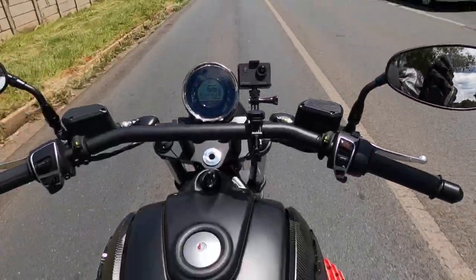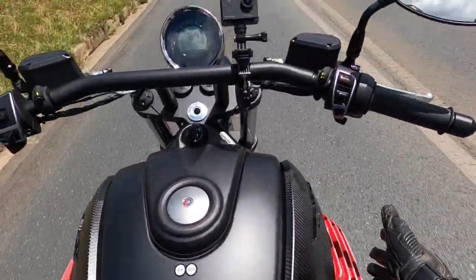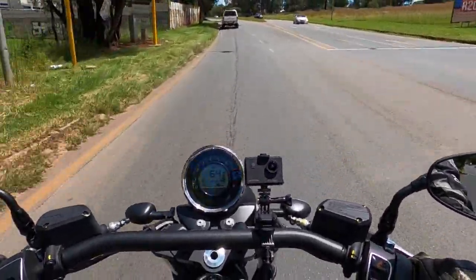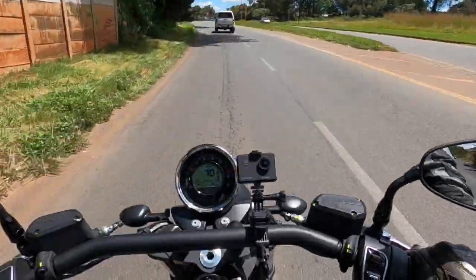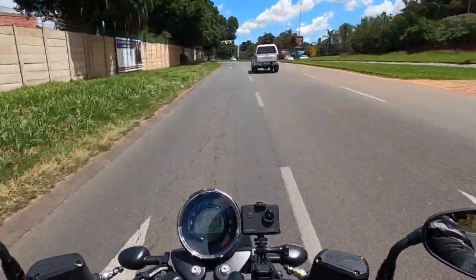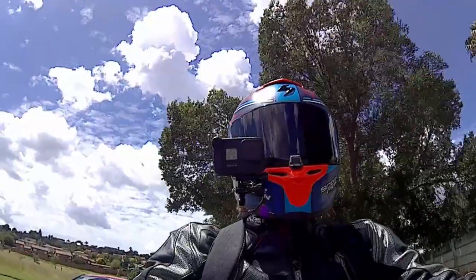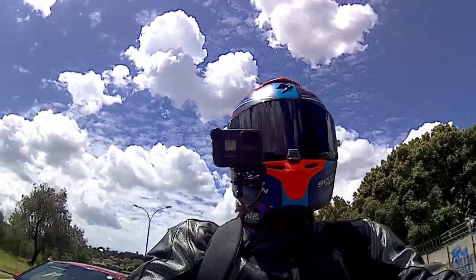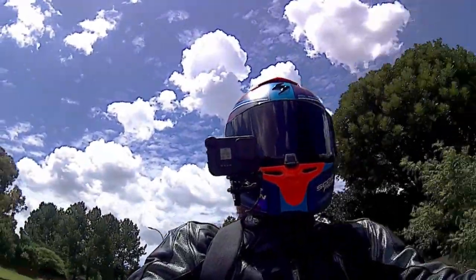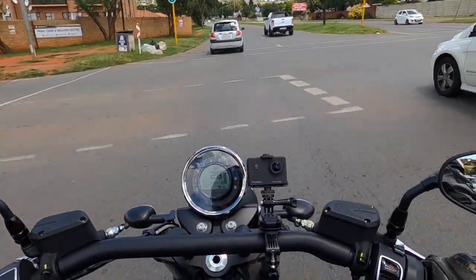The first thing you notice when straddling this bike is this big massive tank, these carbon pieces on the outside with the red heads either side of the traditional Moto Guzzi 90 degree V-twin mounted transversely. It's an air and oil cooled motor, as all of them. However, this is the monstrous 1400, 1380 cc to be exact, producing 96 horsepower and a monstrous 121 newton meters. This is the Euro 4, and therefore the last of these big motors before Euro 5. They couldn't produce these anymore.